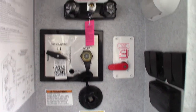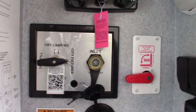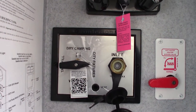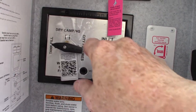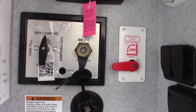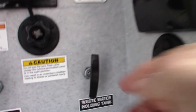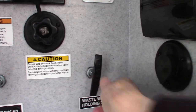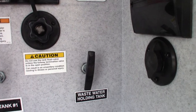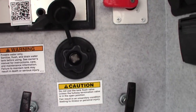This is your water station — your water hookup right here. In this position it's city water, so that's just regular city water. If you're going to a campground without plumbing on the site, you can pre-fill the tank right here. Once full, you go to the campsite, put it in the tank position, and use the onboard pump to pump water out of the tank — everything works just as though you have city water. If you have city water, you don't need to fill the tank at all. Gray tank number one is here, gray tank number two is in the back, and this is the black tank for your toilet. When you dump it by pulling the valve out, you can hook the dump station hose right onto this valve and flush out your black tank to clean the sensors.